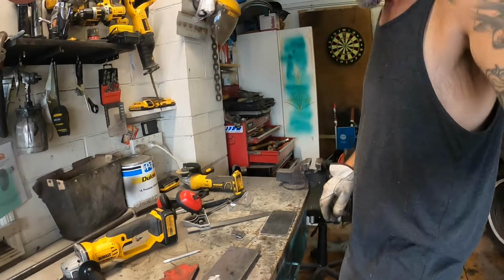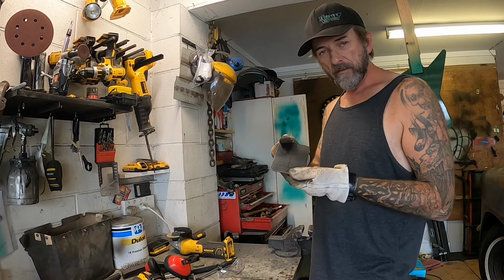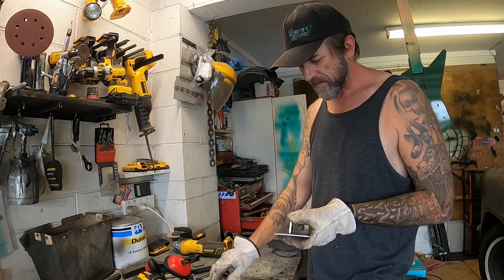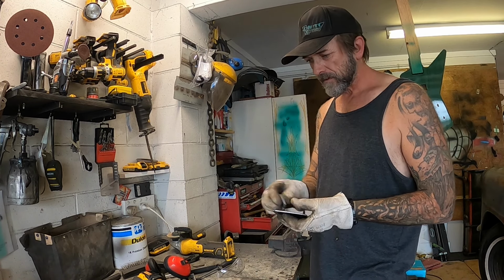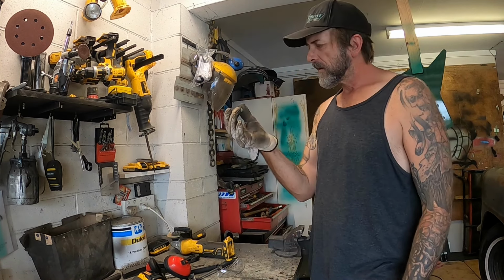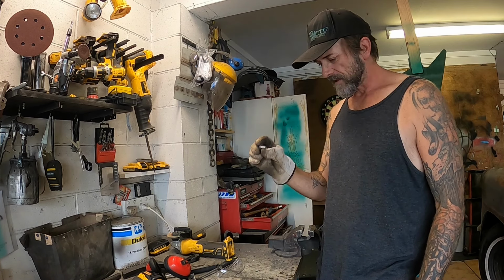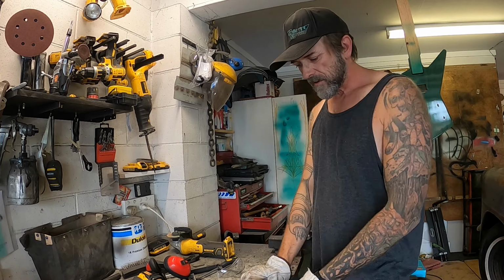Okay, right. This is my pieces cut, so this is my underfloor plate, and then this is going to be my tabs that will come up through the floor. I'm going to tap those. These are the original bolts that were holding that little handbrake lever on into whatever that donor car was, so I'm going to tap these to that, and then I've got to put a slot.